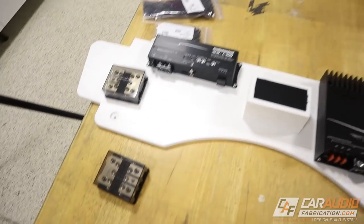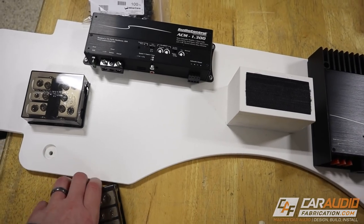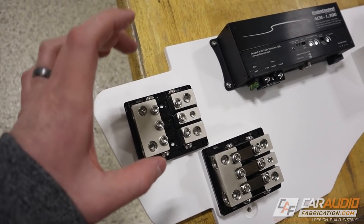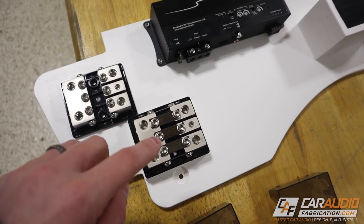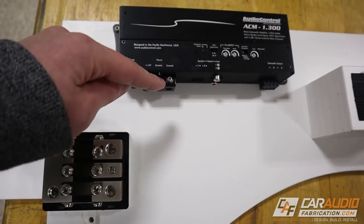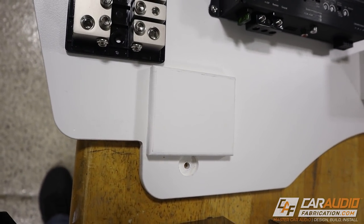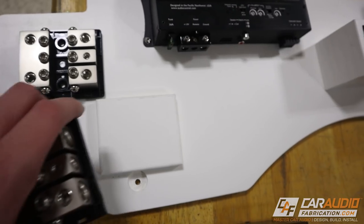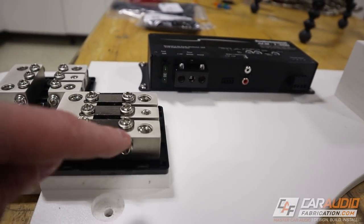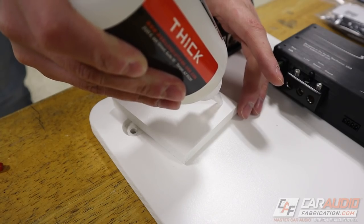We've got all the different wire and gear and accessories that we need. First thing I want to do is determine my layout on the amp rack. I know that I need my power distribution to be somewhere over here. I'm going to have the power distribution block right here and then the ground distribution block right here. I'm going to have a wire that needs to cross over here — this is a cool idea from my friends over at Five Star. You make yourself a little spacer block like this; it allows the distribution block to be lifted up slightly higher so the wire that comes out of this can go up and over the others without interfering. So we have a plan here.